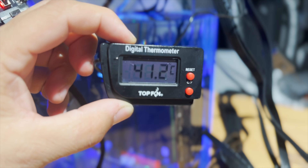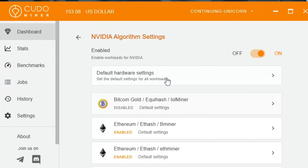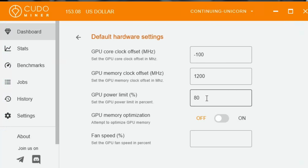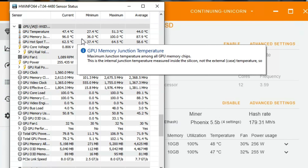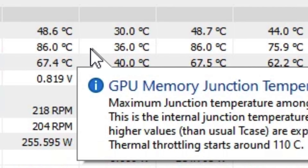About four hours have gone by. This tank came with a little electric thermometer — it looks like it's gotten up to about 41 degrees Celsius and it's staying there. Right where the coolant comes out of the radiator, it's 36 degrees — five degrees cooler. The fancy fan controller for the radiator has a high and low setting and I'm able to keep it on low and it's still removing enough heat to stay at equilibrium. Looking at the overclock settings — same for both cards, both non-LHR 3080s. The liquid-cooled-the-normal-way card is running in the 40s with memory junction temperatures in the high 90s. The immersion cooled one is also in the 40s, but memory temps in the high 80s, which is just lovely to see on a card running at 95-ish MH/s.